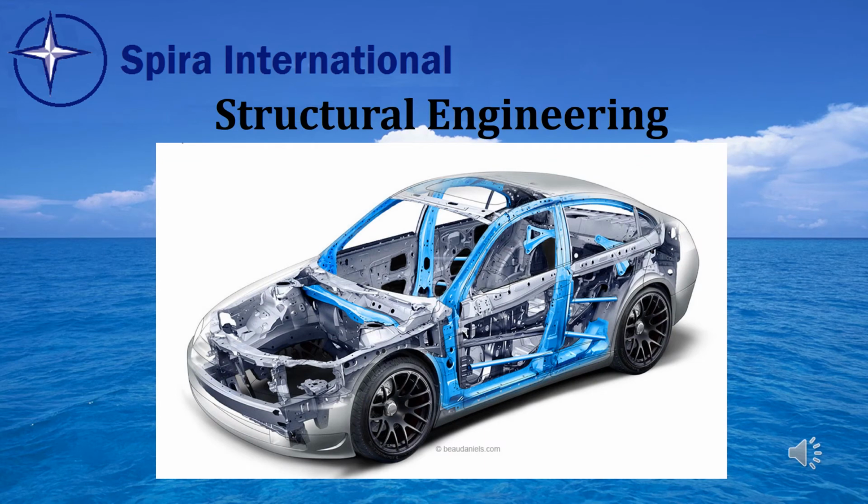Modern vehicles don't use these big sturdy frames though. Here's a modern car, and you can see it uses a unibody. That's an assembly of panels that kind of form the shape of the body anyway, and they're welded together into a unitized structure. And this serves as the main body of the car, the main frame, without actually having a frame.